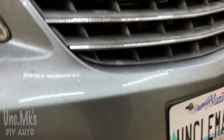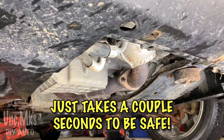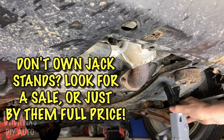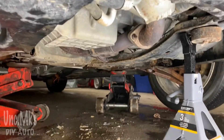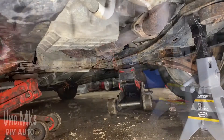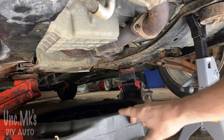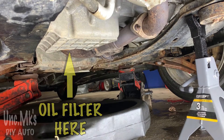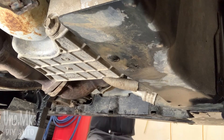Safety first — it just takes a couple seconds to be safe. I'm gonna put a jack stand under there. It's always good to have a couple of these — I just bought two more a little while ago. The oil drains on this side, right beside the oil filter. I'm gonna stick a little bucket in there and show you from the opposite side.